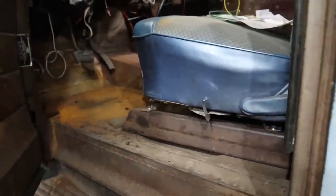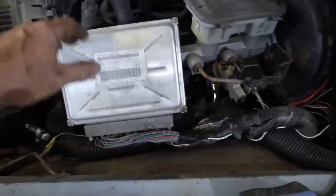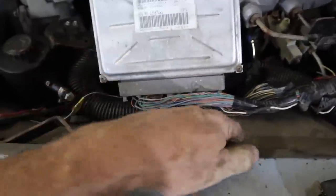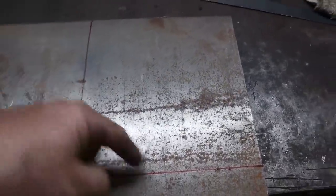You can see I got my seat rail kind of half made. There's a little bit of excess old bracketry I got to get out of there, and then I can zap that seat in place. The upper part bolts in so if I weld the bottom, it should be fine. Now I got to do my brake pedal underneath there and the brake switch — that's next. I got to build a PCM mount. Normally I use the ones from the S10, but it's not a lot of room on this side. So I'm going to build a stand-up mount that just sits here that I can tie the PCM to. I'm going to make a mount that comes up and down and bolts down to the fender — it's going to have a flange on the bottom. I'm going to angle the sides just to give it a bit of a kink so the module can't go left and right. I'll cut this out, bend it up, and show you what it looks like.